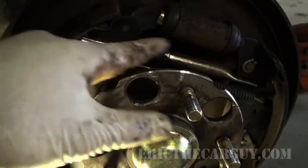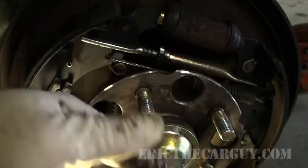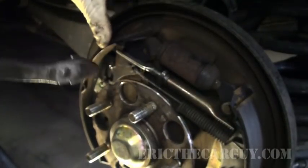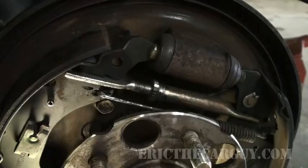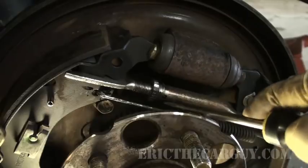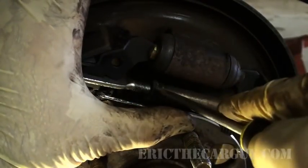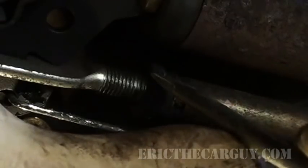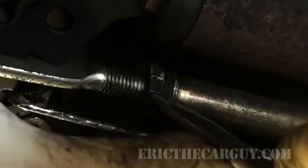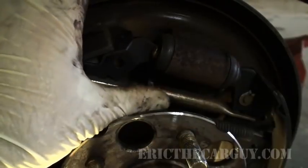If you're having a lot of trouble and can't get to this stuff, there's just one nut holding the hub and bearing assembly on — you can just knock it off, take the whole hub assembly off, and it's completely out of your way. Going to try a different strategy. The biggest reason I'm having trouble is this spring is under lots of tension, so to help alleviate some of that I'm just going to spin the adjuster backwards. I'm going to be readjusting the brakes anyway. To undo it, just go with the ramp and turn it in the opposite direction — this will release some tension on that spring.